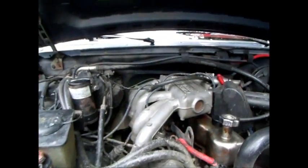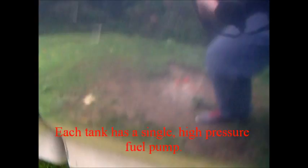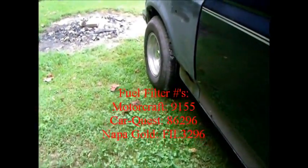Overall, I just want to start off — obviously you guys know where your fuel pump is. If you know anything about your truck, you know it's an electric fuel pump inside the tank. Mine has two tanks, and both have a fuel pump in it. Your sending line comes out and right about where the cabin door meets, goes straight under, and on the inside of the frame rail you will find your fuel filter.